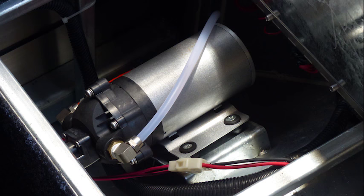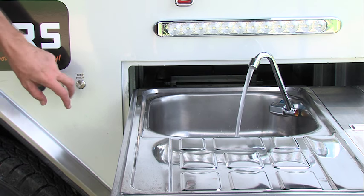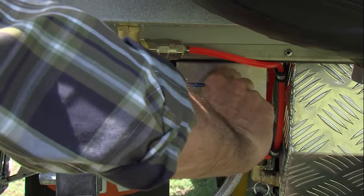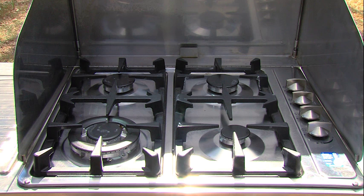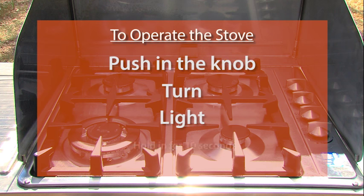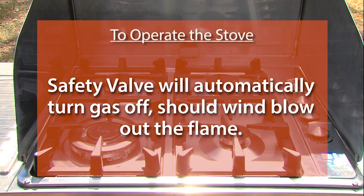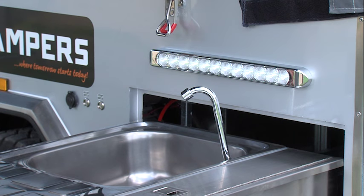Water to the sink is supplied by a pressure pump and, once connected, can easily have the flow turned off or on by raising or lowering the tap. Now here is the winner — a real four-burner gas stove correctly installed, fitted with a safety device and supplied with a gas certificate ensuring all safety standards are complied with. This gas stove is big enough to boil water for mud crabs or corned beef. To turn on the stove: push in the knob, turn, light, then hold it in for about ten seconds. This is necessary due to the safety valve which has been fitted, which automatically turns the gas off should wind blow out the flame. An LED light above the kitchen means you can at least see what you're doing.